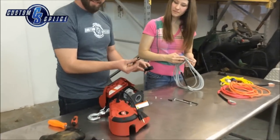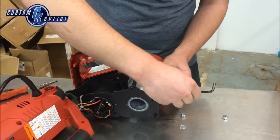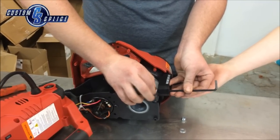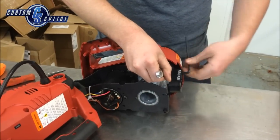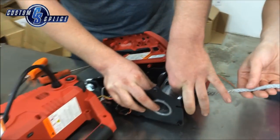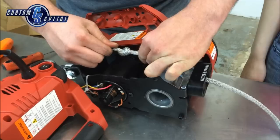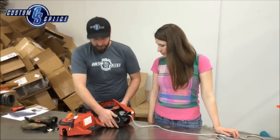Since we're using all the stock hardware, take your screw that you just took out, slip it in the countersunk hole, slip it into the existing mount, and if you need to you can use the Allen screw to keep it in place and just thread that on. Thread the nut on. It already uses locking nuts so you don't have to go overly tight on these. Once you have your fairlead securely mounted, you can take the dead end of your 15-foot rope and simply press it in through where it would come out, pushing it through the drum, pull out a couple inches, and tie a simple overhand knot. Pull it back through up to the opening and just lay this side over.